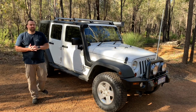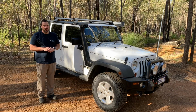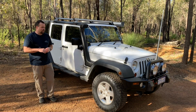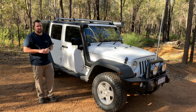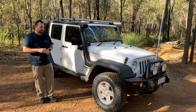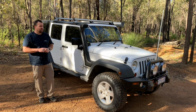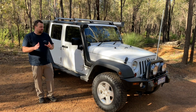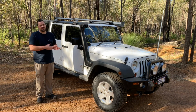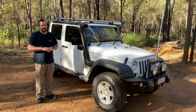It's hard to say. There are multiple issues if I would go diesel again. Powerful, yes, it's just over 200 horsepower off the shelf. The issue that really is there is the cost associated with servicing. It's a 6-month service cycle or 10,000 kilometers, and it has to be done at the lower of the two because of basically the DPF that's in it as well, which is another issue in itself. The petrol, on the other hand, is a 20,000 or a 15,000, sorry. And then it will basically save me money because I don't drive enough kilometers on it. I only drive it about 15,000 a year. And if I drove it in that 20,000 to 30,000 a year mark, I'd probably actually save more money.